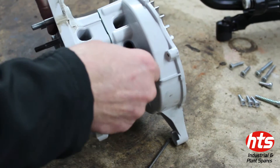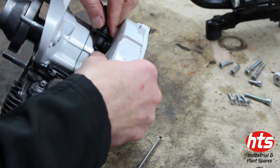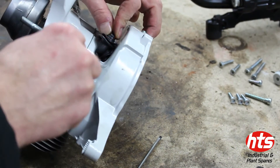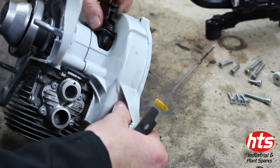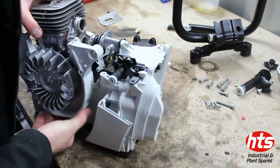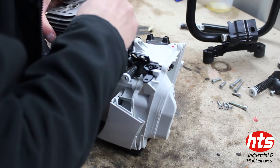Place the hose in the correct position and make sure it's a tight fit. Next, place the crankcase assembly on the fuel tank assembly and ensure the hose fits securely, and loosen any hose clamps to ensure the manifold slides on with ease.